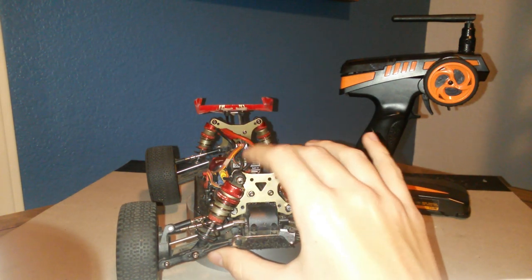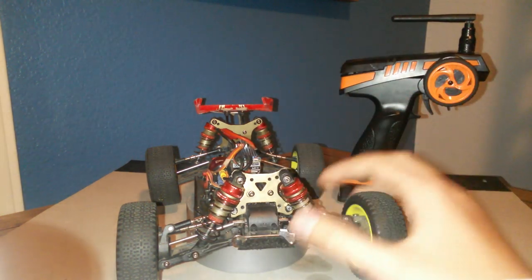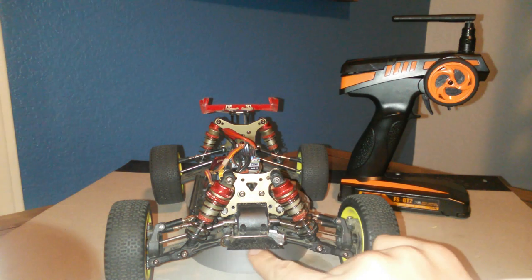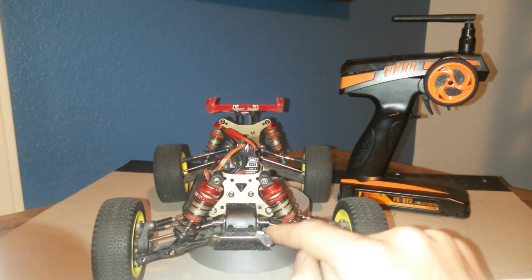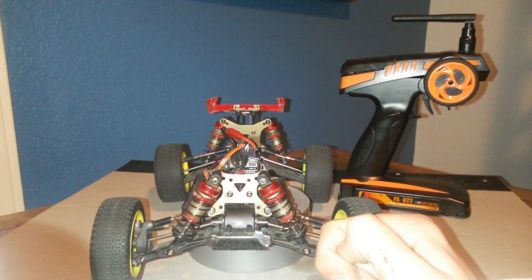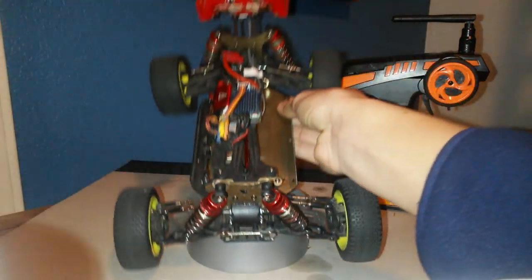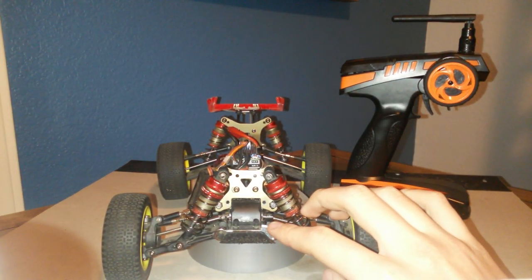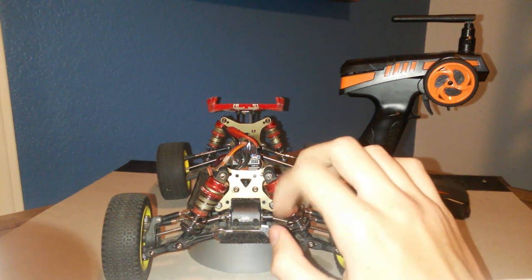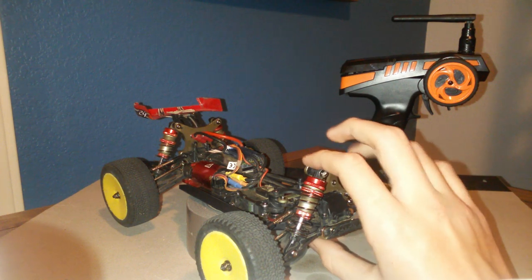Two days after fixing it, one of the plastic cups in the toe blocks snapped open and just fell out, leaving the hinge pin dangling and sliding out. I put in a little bit of silicone tubing from my nitro monster truck to keep it from moving around, and then a little metal plate so it doesn't slide out. It was a five-minute fix because the part was out of stock online. My hobby store had a couple of parts for this thing but they're not stocking anymore because nobody has these cars and the parts kind of suck anyway.